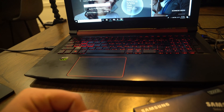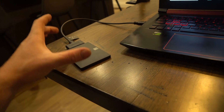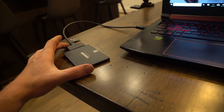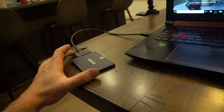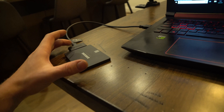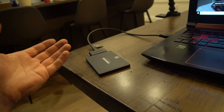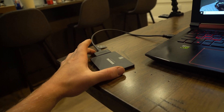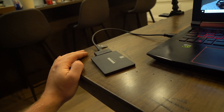What we want to do is clone our Windows and everything else from this hard drive to the next. If you're going to be doing this process, I definitely suggest going solid state nowadays. Don't go with an old-school drive. Make sure that the drive is bigger — I'd suggest a terabyte, a thousand gigabytes at least. We're doing a smaller drive because this is mainly a work laptop and we have a lot of extra storage we plug into it. If you're someone who's going to be gaming lots, get like a thousand gigs right away.